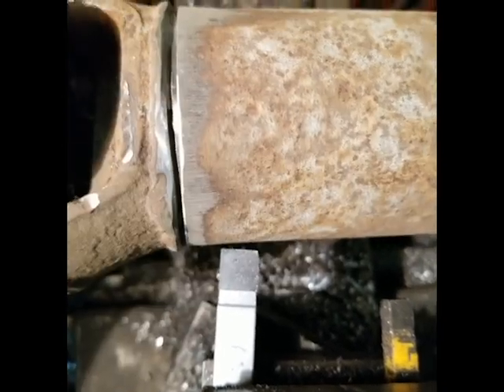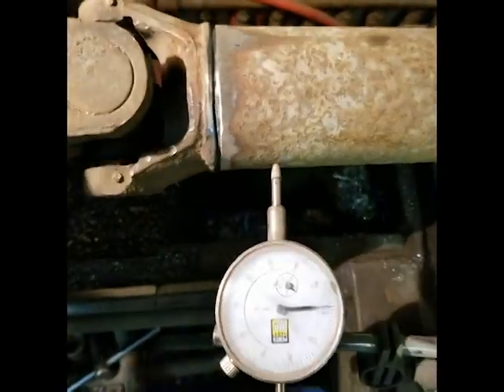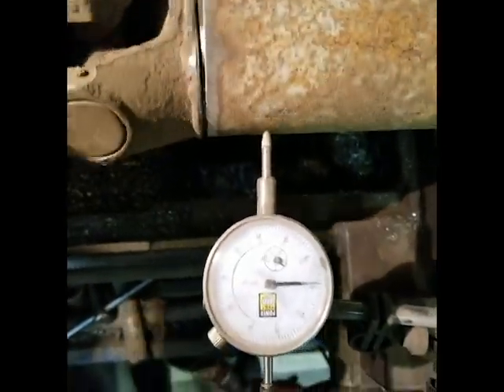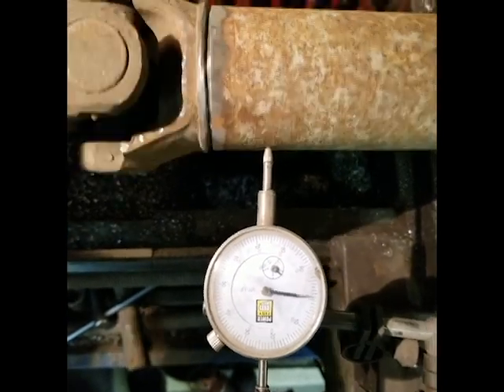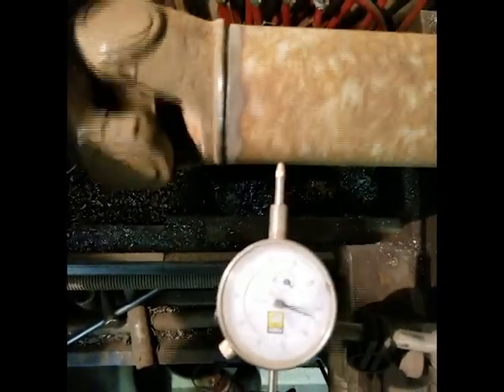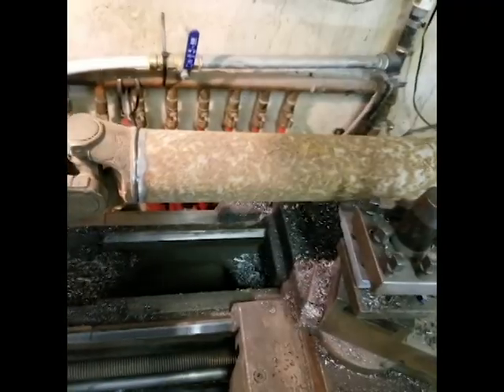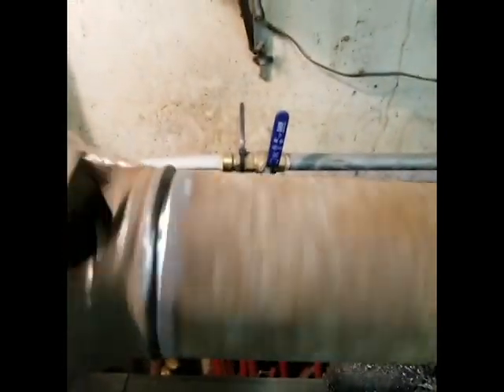You kind of bing-bang it until it's pretty close. I've got an indicator on it now — I kind of banged it around and we're like about five thou out, which you're never gonna notice essentially. What you had going on before you can ignore — that's just because normally it's welded — but the drive shaft is straight as heck.